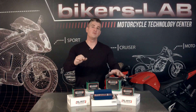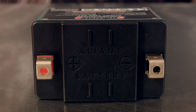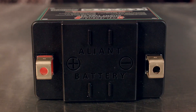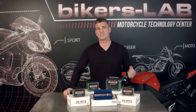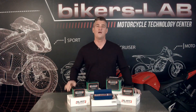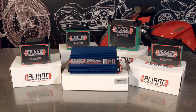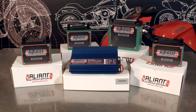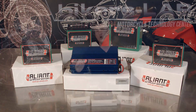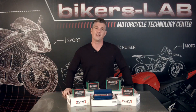These batteries have proven to be more reliable and durable than any other in the market, thanks to high-performance LiFePO4 cells and the custom-designed electronics embedded in every model. Battery lifespan depends on how many times a battery will successfully start or cycle. The Alliant lithium claims 5,000 cycles — if you started your bike five times a day for five days a week, that's 25 cycles a week, and you could do this for 200 weeks or four years before you'd have to replace the Alliant Ultralight lithium battery.